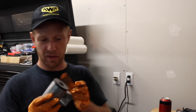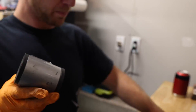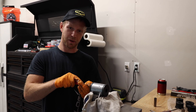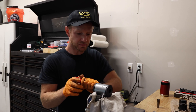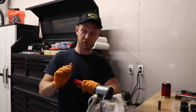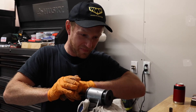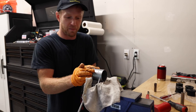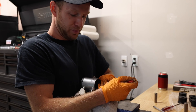The pin pops out through the socket. These bushings are two pieces, as you can see from the new ones. Put the mount back in the vice, take a flathead or curved tool and push it in until you feel the halfway breaking point where the two bushings meet — then drive it home with a hammer or your hand. There go your 70 durometer bushings. Safety first — always push away from you.